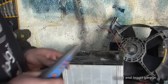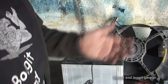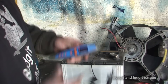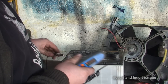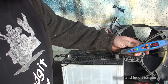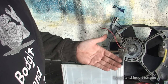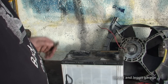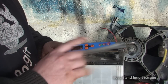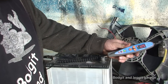We've obviously got our battery here. If we need to test anything electrical to make sure we're getting 12 volts or whatever voltage we need, it's very simple — put it on. As we can see, it says 12.5 volts. So if this was a wire we're testing, we know we're getting 12 volts. If we're not getting 12 volts, we might have a problem somewhere. This also lets you test things like alternators — if this is in your car once your battery is connected, you can test your alternator. You can quickly see whether it's your battery or your alternator at fault.